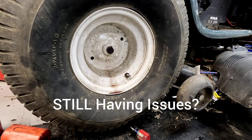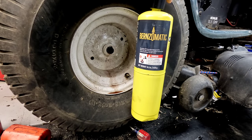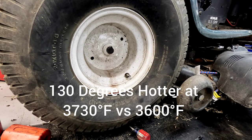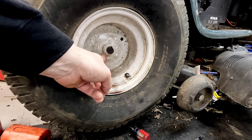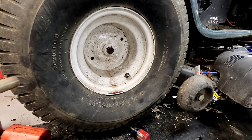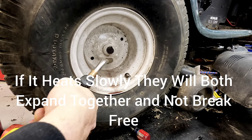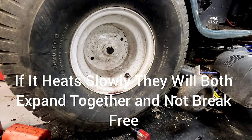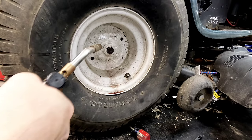If that's the case, you may want to use some heat if you've got it available. We like to use MAP Pro Gas — it heats things up very quickly. It's only about 150 to 180 degrees hotter than a regular propane torch, but that extra heat speeds things up a lot. You always want to heat up the outside of your rim completely around, and you want that to heat up quicker than the shaft does. You don't want to heat up the shaft — you're just wanting to expand the rim so everything can pull off.